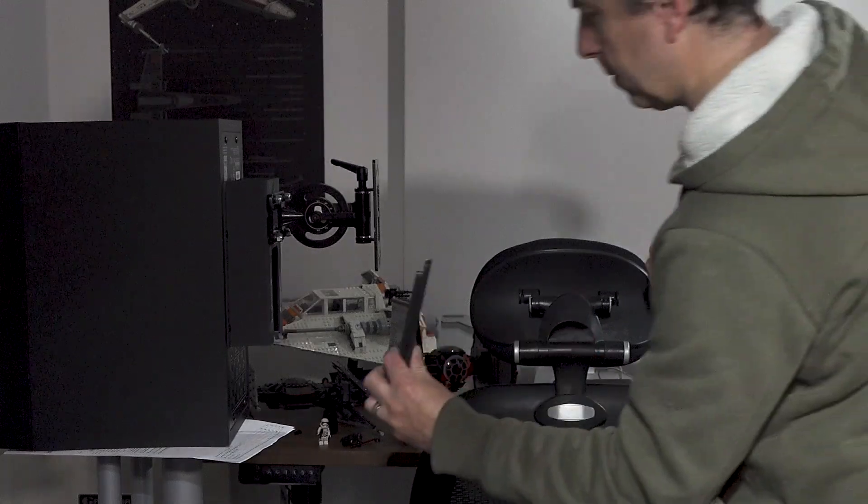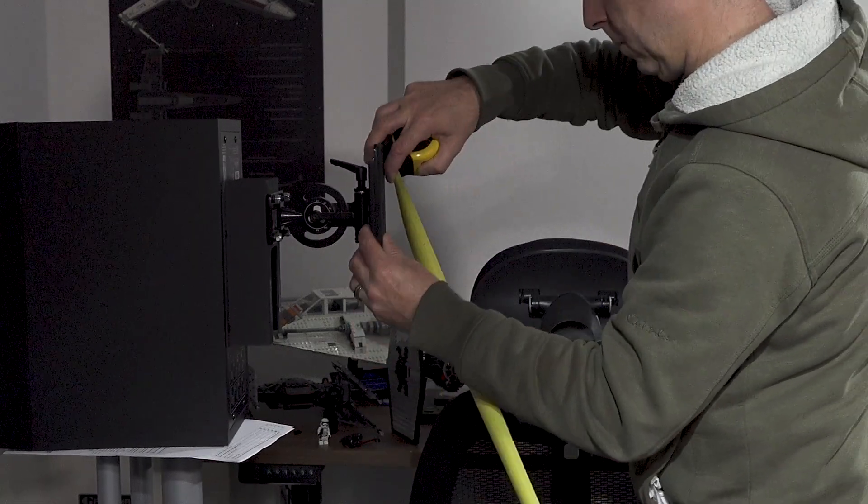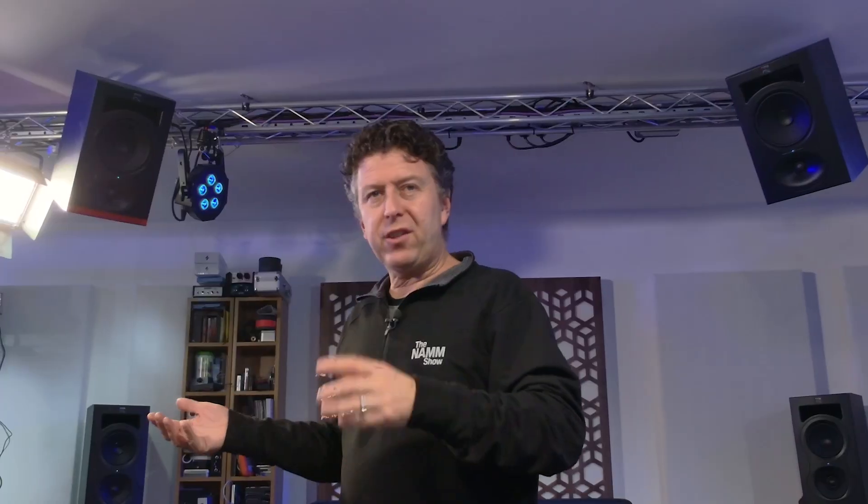Positioning-wise, I was incredibly lucky again. This is one of those things where there's very little actual documentation. The rears should be around 140 degrees from centre — from north, if you like. And it turned out, again by some sort of magic, that 140 degrees ends up with the speakers between the acoustic panels. So 140 degrees from centre to the left and 140 degrees from centre to the right takes me bang in between the acoustic panels — very, very lucky. They're the same height; I had to work out the exact height to put the brackets on the wall, but that was some basic maths.